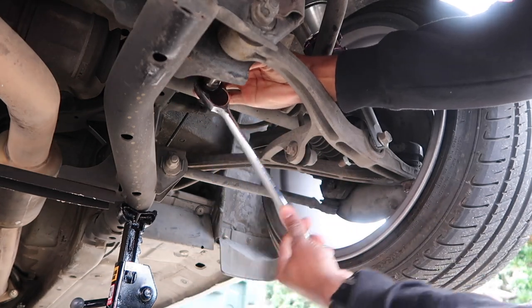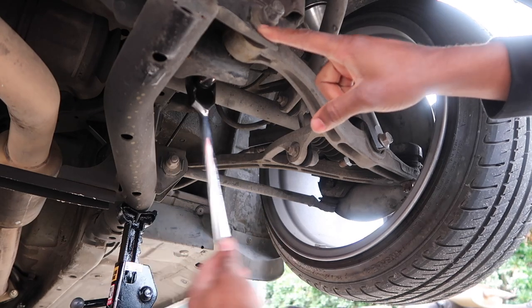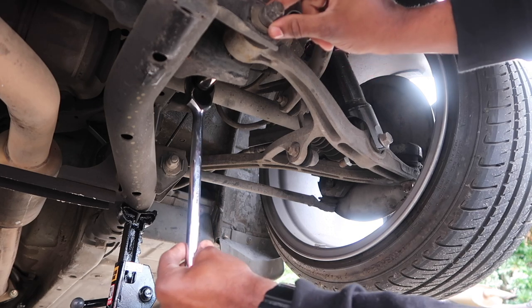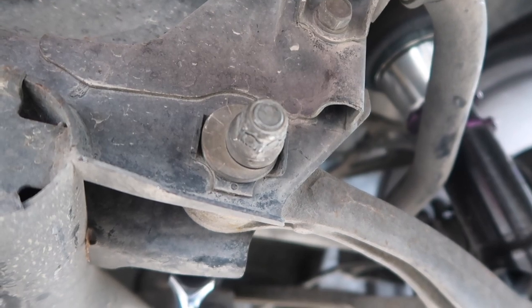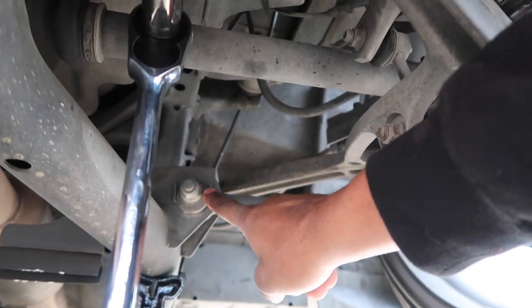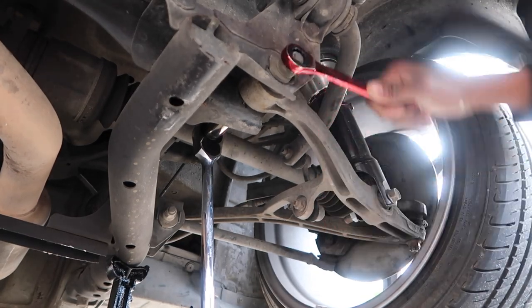See, it wasn't hard at all. You just turn this so it rotates onto that side and boom — make sure that's about lined up right there. That's the middle, that's about max camber. I'll show you a little closer — see that right there, that's about max camber, just about max. But then you're gonna have to mess with this bolt down here and adjust it because the toe is gonna be off and your tire is gonna be leaning inwards instead of straight. So I have to go adjust this bolt right here too, but first let's tighten this side up.